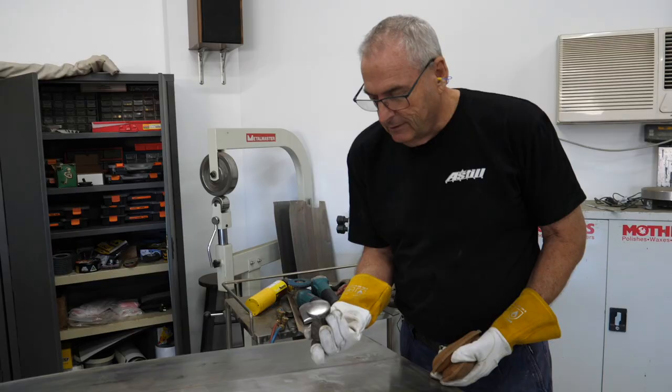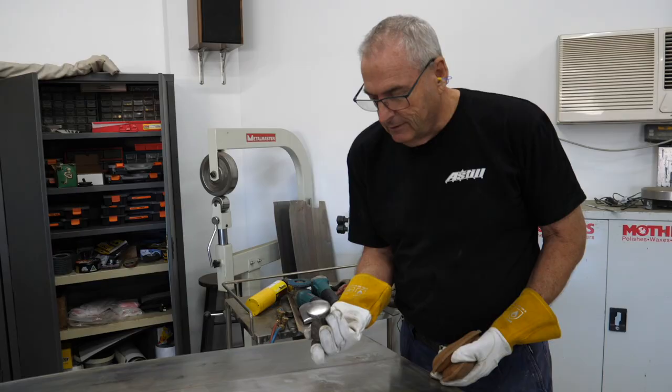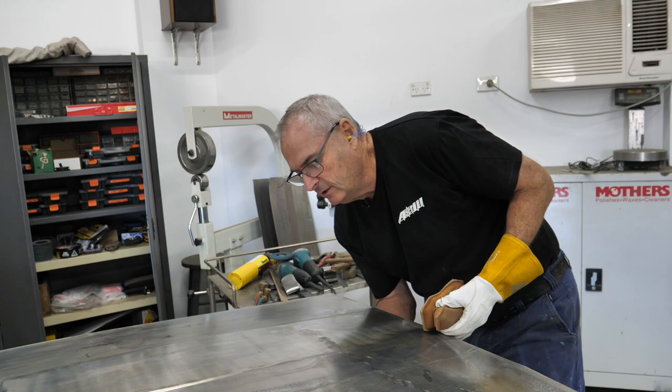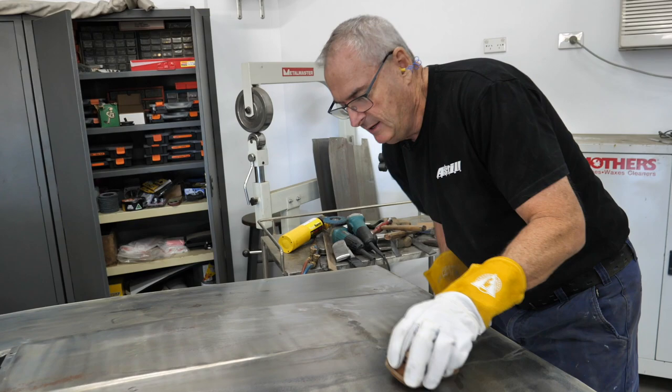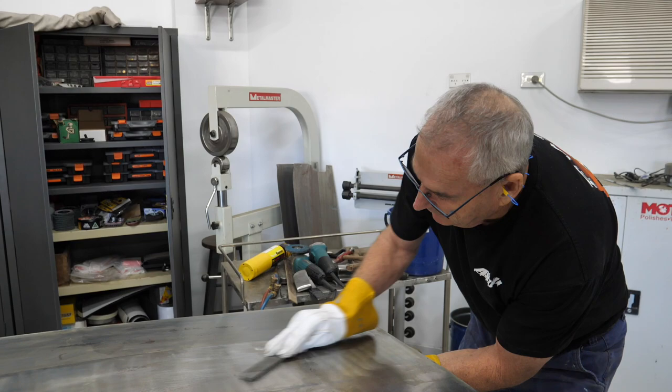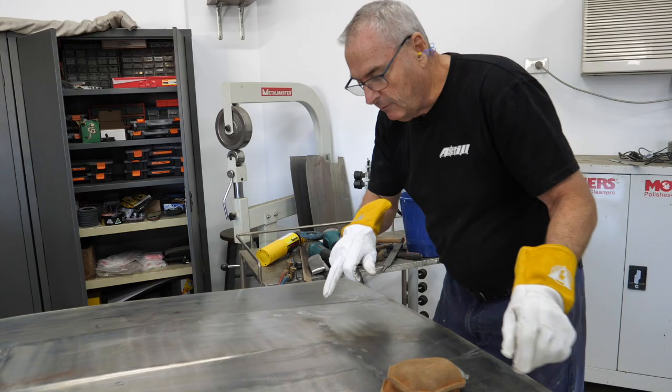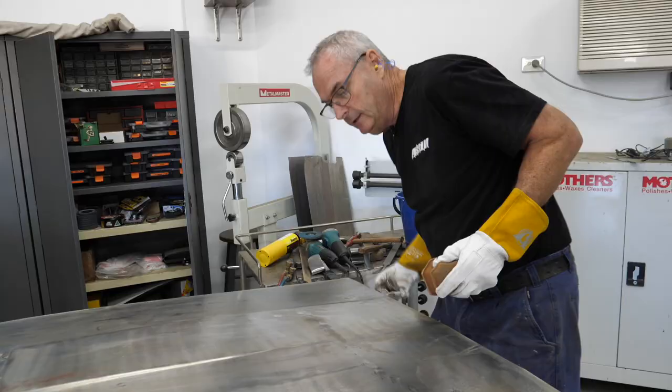From here it's really good. We've got a low and another big low here - where I've shrunk it's probably a little bit much. These welds are pulling it down. There's not much in it though - you could get away with that if you wanted to. Now that we know where the problems are, get the little roller in the back here again, give that a rub up, and then knock that down. By rubbing it up with the file you get a really clear indication of where you've got to hit it. We've reduced the size of that down to half. In a true file finish you'd be in the back knocking it up, knocking it down, file, file, knock up, knock down - until it's all perfectly flat.